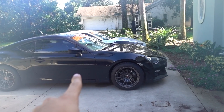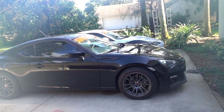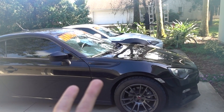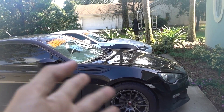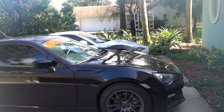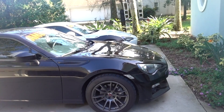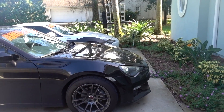Right when I was outside of my neighborhood, the BRZ actually died on me. So I pulled the codes for the check engine light, and sure enough it's for a MAF sensor, intake temperature high output, and then something with one of the direct injectors — which makes sense because this thing has just been going through fuel. So obviously we've got some things to work out with this car.